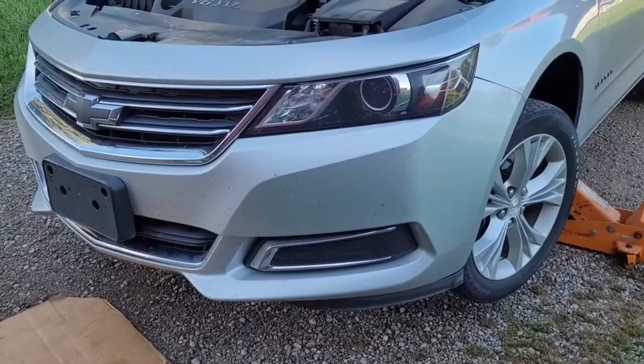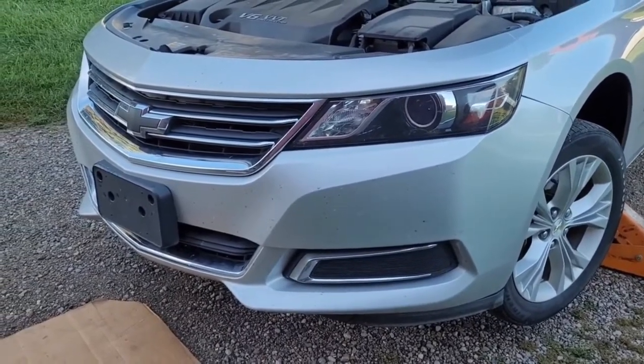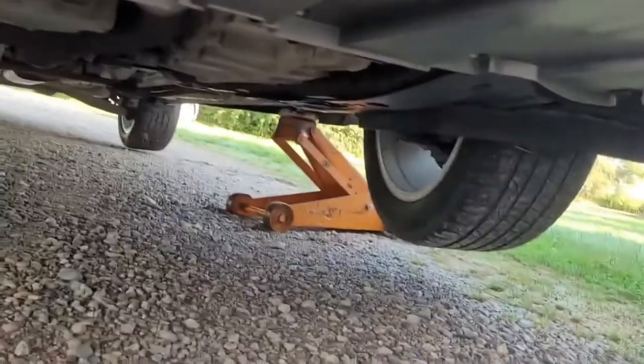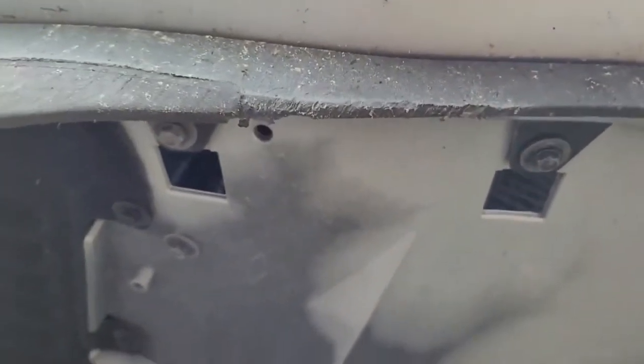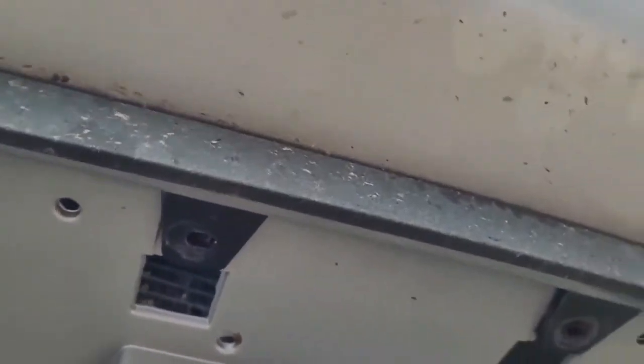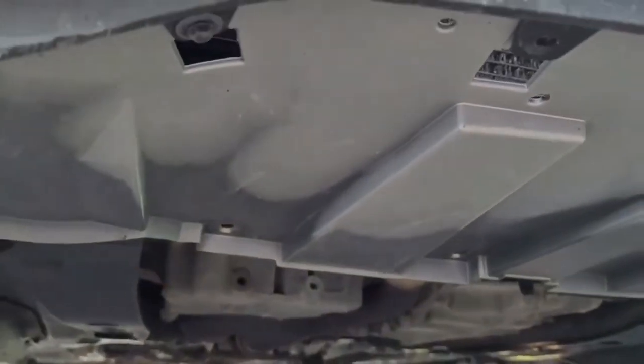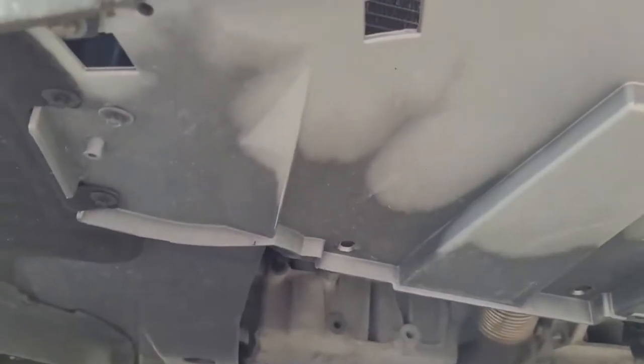Come on along and we'll see if we can get this thing troubleshot. With the vehicle jacked up on the front end, the bottom panel there has seven millimeter bolts — there's one here, here, along this front edge — and it looks like at one point some bolts were removed and not replaced, so somebody apparently has been in here before.